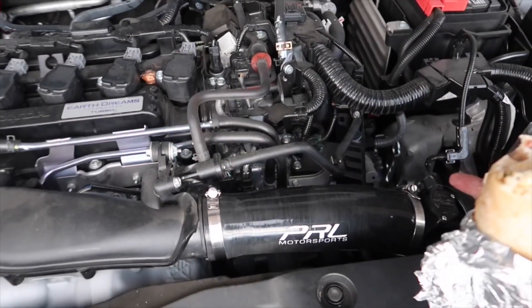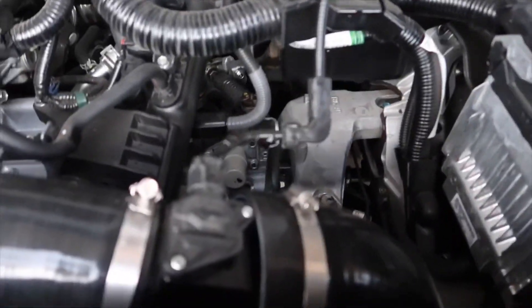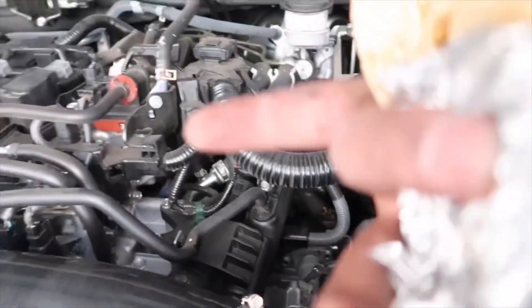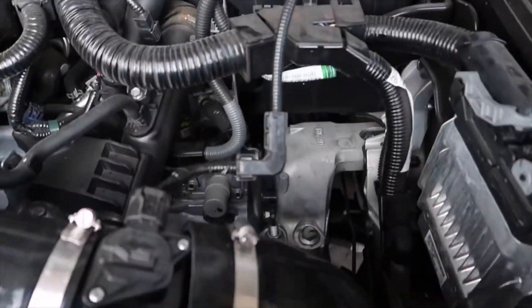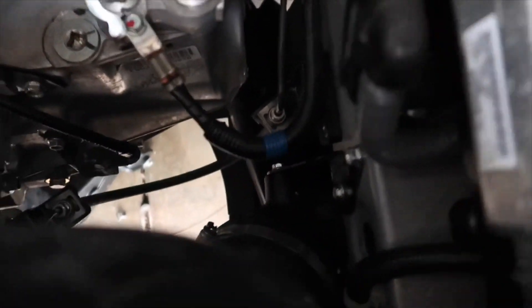I decided to take a break — it's pretty much done. All I got to do is tighten up the bottom parts but this one is pretty straightforward. MAF sensor — this is a very important part. It has an arrow pointing this way, going toward the turbo. Make sure the arrow is pointing that way because you don't want it to throw any codes. From there we just tighten it down. This one is tightened, and the other one right there is tightened. For the cone — when you're underneath the car you want the top of the cone to go on first, then pull it down so the bottom one grips it. It's mixing plastic with silicone but it's really not hard — I found it to be easy.